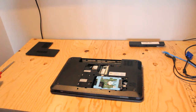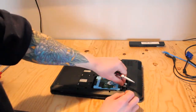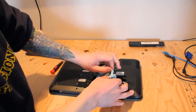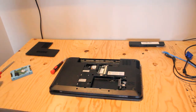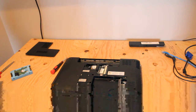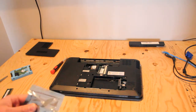We'll start by taking out the hard drive — there's one screw right here. We'll remove the caddy by pulling down and lifting up. It's a Western Digital 640GB hard drive. I did end up reinstalling Windows 7 and getting the correct drivers to work for this wireless network card. The hard drive is working okay now that I've formatted it, but we're looking for a long-term solution. I think an SSD will really add value and performance, even though it is at the sacrifice of storage space.